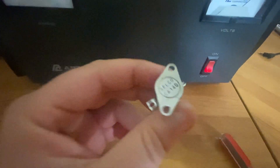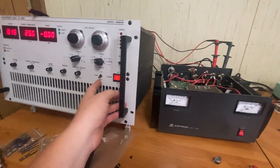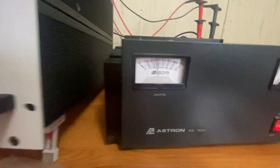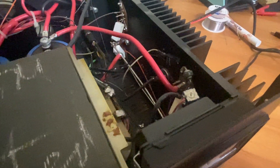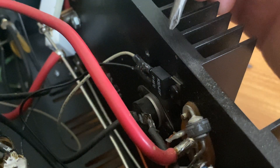The original is a 60 degrees Celsius thermal switch. I've got the power supply hooked up to my electronic load and I'm going to put a 25 amp draw on it to try to warm it up and see if the new switch I put in will rectify the situation. You can see right there — that's the new thermal switch I put in, and there's a second thermal switch just below it. The one on top is the one that actually controls the fan.